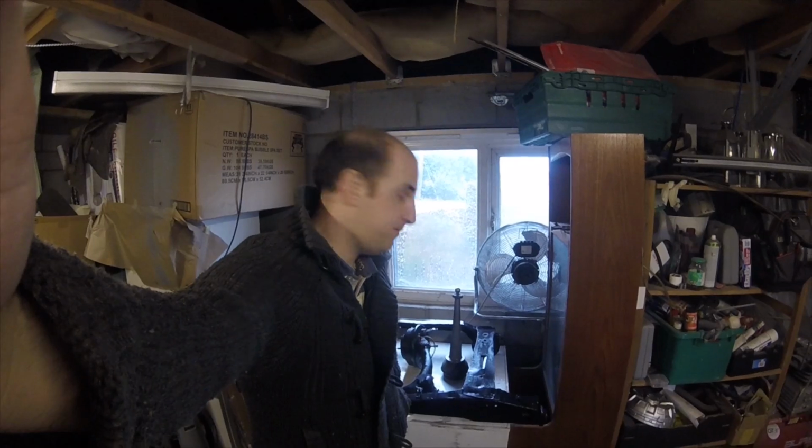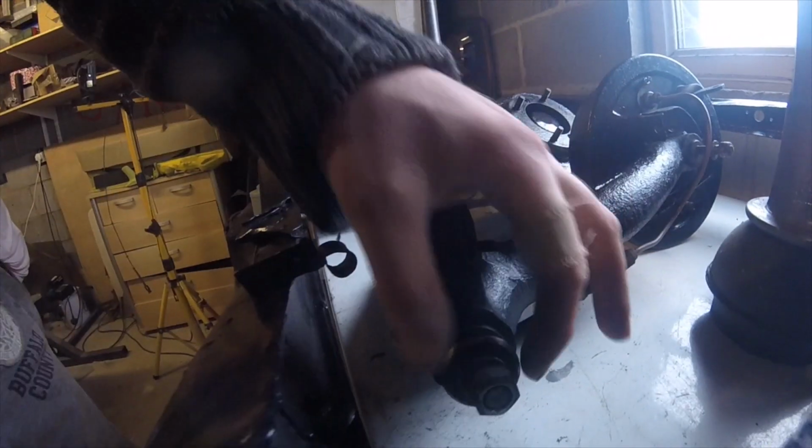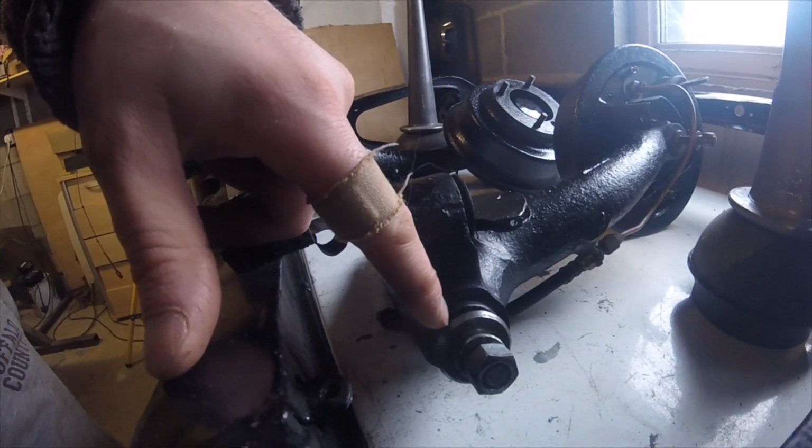Hey, so I know I haven't filmed all of this, but I'll show you what I've got. Pretty much just a strip back and paint, and also recondition of the radius arms, including having them reamed. So we've got new inserts in here. Missing the dust covers at the minute, just need to put those in at either end. So it's new through there.